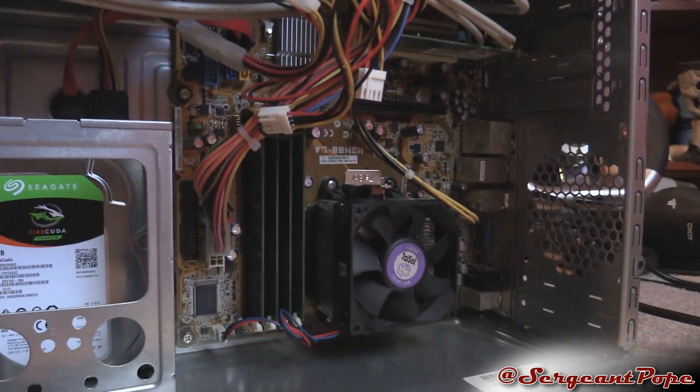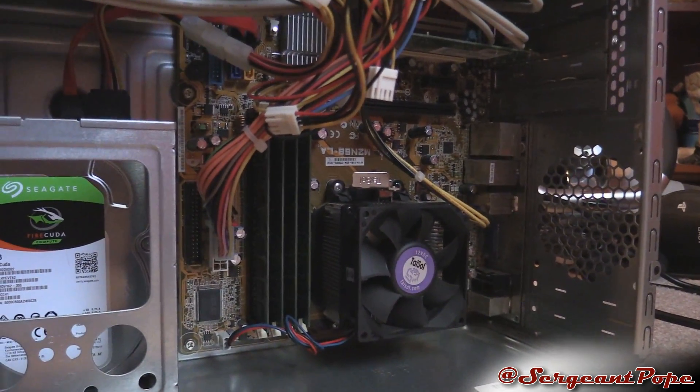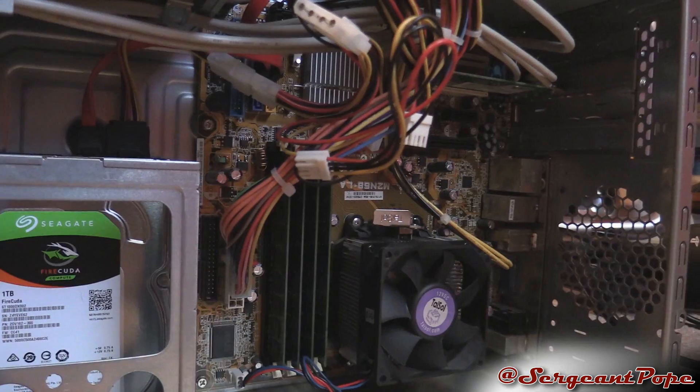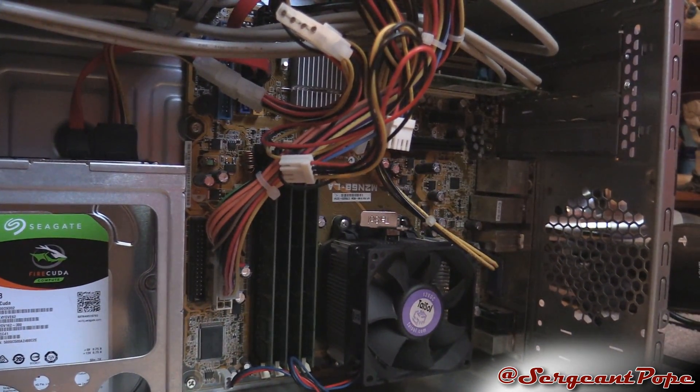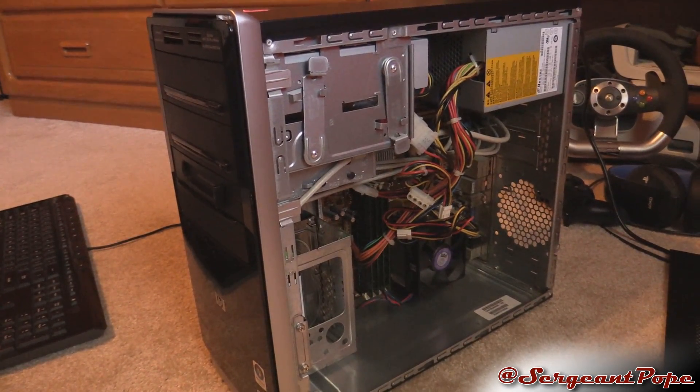It's probably the motherboard and possibly the CPU, and in both cases it's usually expensive to fix since motherboards and CPUs are pricey. For an older computer, some components like RAM may not be compatible if you buy a new motherboard or CPU. I went ahead and looked for a BIOS update - there is one, but with HP computers you can't do it through the BIOS itself, you need to do it through the OS, which doesn't really make sense in this situation. I tinkered around with some BIOS settings anyway and it didn't fix it. As you can see, the computer is totally off and I didn't turn it off. At this point it's probably the motherboard or the CPU, and definitely something costly and annoying to fix.